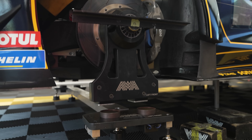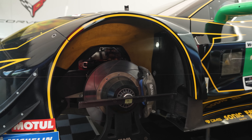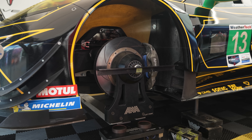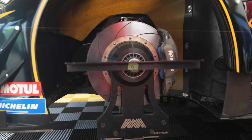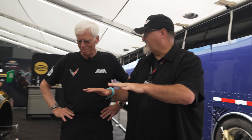We're communicating by Bluetooth. The readings are sent from the load cell directly back to a central head unit on all four corners. We call this the setup pad - we're creating a truly flat and level platform for the car to sit on and be measured against.